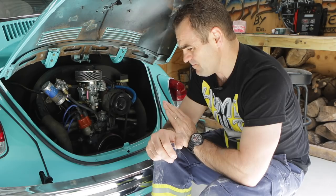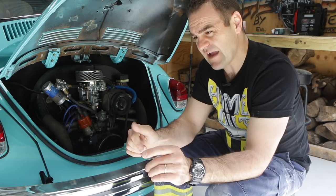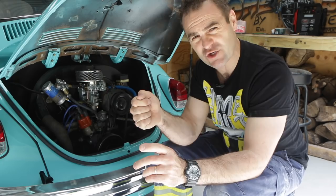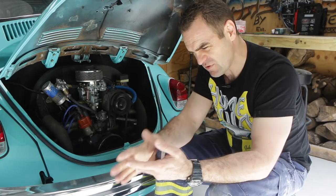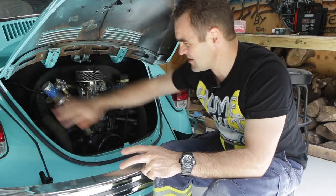The valve seems to work, but maybe the float isn't quite hitting the top as much as it should. So maybe the fuel is slowly leaking past that, because when it's warm, if I turn it off and straight back on it starts no problems. It's only when I leave it for about 10 or 15 minutes and then it's really tough to start. I need my foot flat to the floor, wide open, and I can just get it to catch after a bit of cranking — obviously running really rich.